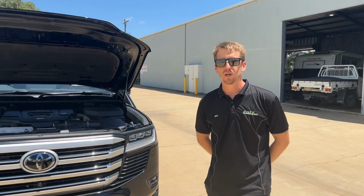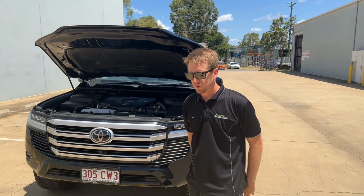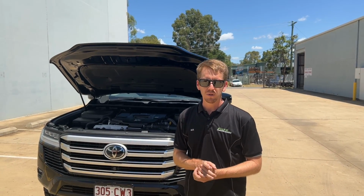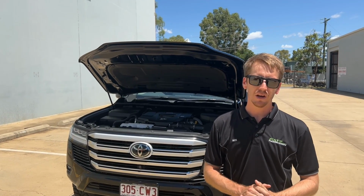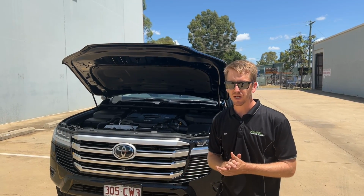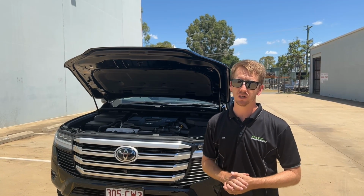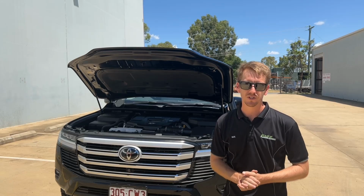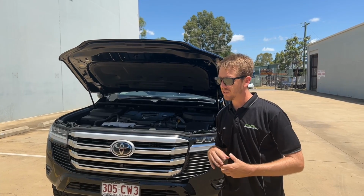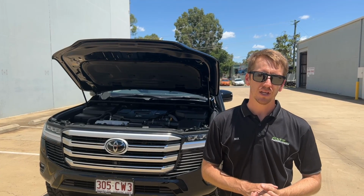At the request of the Just Autos team, our next project that we undertook for this vehicle was the exhaust. So what we've come up with is a few different options or renditions. So we have a product for every end user. So what we started with was, again, 3D scan files and our 4-inch exhaust. So we've done a DPF back with our 4-inch system. We've done a 3-inch DPF delete to work with the factory system. And we've also done a 4-inch turbo back system, start to finish on the car. So all these items have come up really nice. Again, we used the 3D scan files. So we had the tubes mandrel bent before the car came here. And then all we need to do from that process is add our mounts, our flanges, and create our jig.